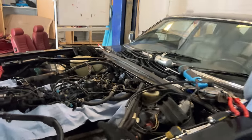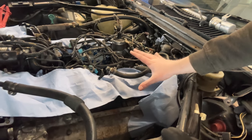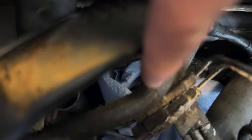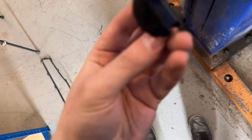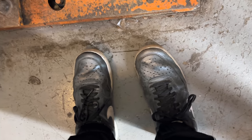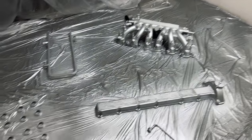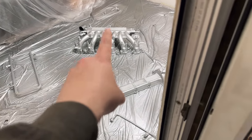Covering the open engine reduces the risk of anything falling into it. Just look how much there is in this engine bay - the amount of wiring in this thing is mad. You have to take all of this off to get out the camshaft cover and the induction manifold to get to what is right back here. Honestly, there's no space at all. Right at the back there is the space for this to go - this is one of the half moon gaskets, and I believe this is what is leaking. It is a bit oily on the bottom. The spray-painted parts look unbelievable - that's going to look so cool going back in the car.